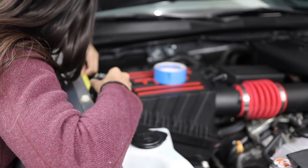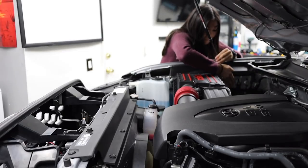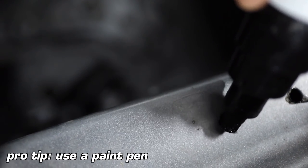I don't think it's a bad idea to invest in an electric rivet gun — it definitely would have sped up my process by a huge factor. If you don't like rivets, I've also heard that people have done this install using sheet metal screws instead. That's probably easier, but the kit already comes with the amount of rivets you need plus an extra one, and I just wanted to follow the instructions as the product was designed. As long as you measure correctly and carefully, and point those balls on the brackets in the right direction, this install should go pretty smoothly. You should also paint those holes to prevent rust. Overall the install went pretty smoothly and the end result is just awesome.